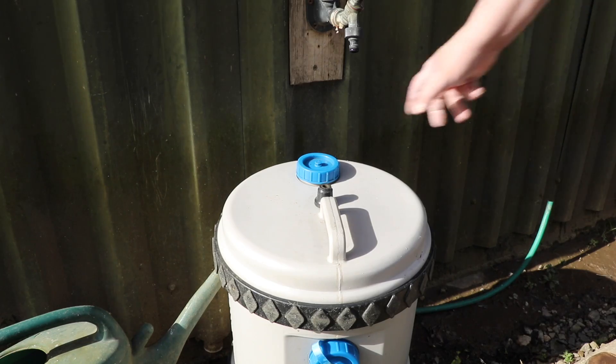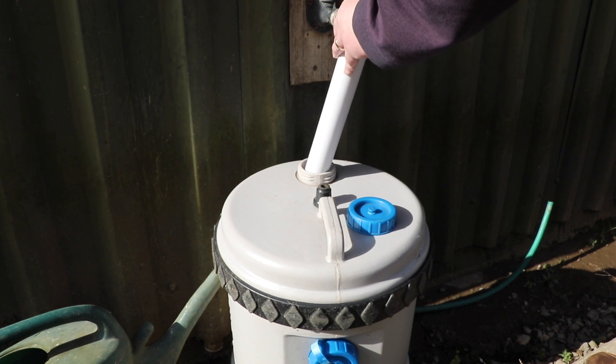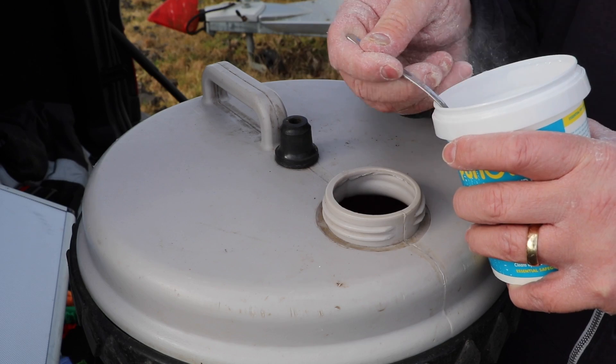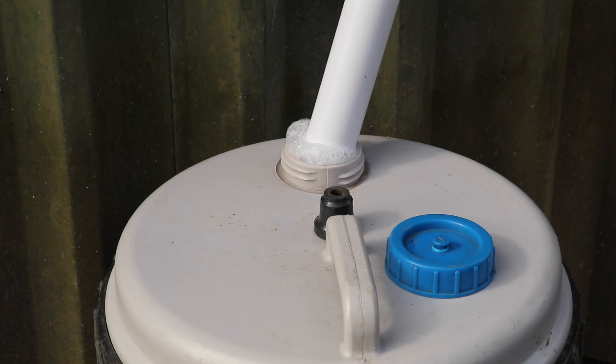The first step is to fill the Aquaroll. We're sterilizing the Aquaroll, the pump, the pipework, and the taps — the whole fresh water system. Fill the Aquaroll halfway, add the PuraClean, then fill it right to the top. The dosage is one teaspoon per four and a half litres. For a full Aquaroll that's between eight and nine teaspoons — we go for eight and that works fine. Once mixed, give the Aquaroll a good shake and leave it for a couple of minutes to start dissolving and acting inside.